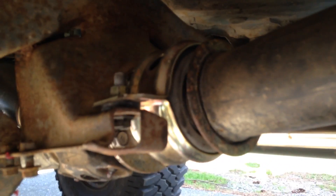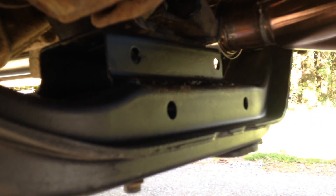This bearing was quite new. I moved the bearing up onto the top of the support because I had to lift the transmission up to match the engine. I just cut a chunk out of another cross member and welded it onto top of this one. I'll probably go out and get some flat metal and make myself a new cross member — this was just to get everything working and make sure I didn't have any other issues.